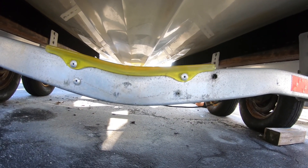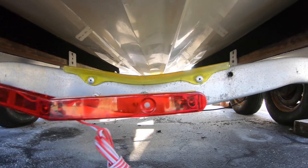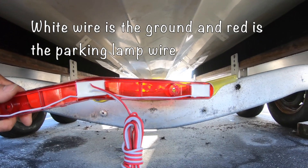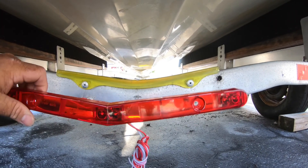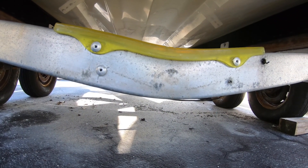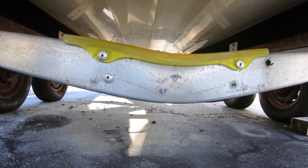What used to be a center light for this trailer is now gone — the only thing left is the rivet — and we want to install a new one. It has two wires on the back, a white and a red one; one is the ground and one is the power for the parking illumination. First thing we're going to do is drill out the rivets, install self-tapping screws, and run the wire over to either the starboard or the port side tail lamps.